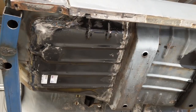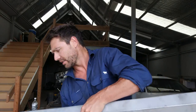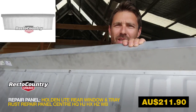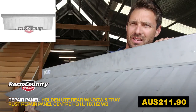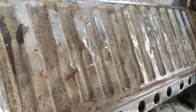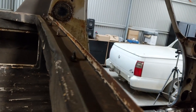That's the floor pan done. I want to give you an update on a couple of other things in the workshop. One of the major panels I wanted to do is the rear wall of the ute tray. You can actually get this whole panel replaced. I was umming and ahhing about doing this or just bashing out the original, but the original is just too far gone — too many small bump marks and the whole area has been caved in from heavy loads. This part is about $220 — not exactly cheap, but it saves you a lot of time.